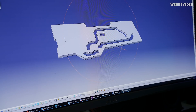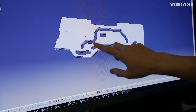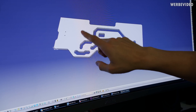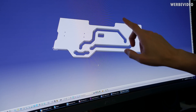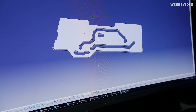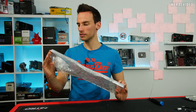It's time to go back to the computer and finalize the distro plate design in CAD. The water channels start from the pump-reservoir combination, go into the CPU, come down from the CPU into the GPU, then go from the GPU through a channel back to the radiators. We have a hole for the cables, mounting holes for the GPU, a small cutout for the GPU IO shield, and holes for mainboard cables. I'll send this file to Sven from Steelkey Customs — he'll take care of the o-ring channels and additional screw holes.